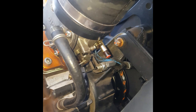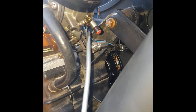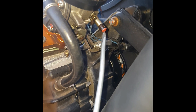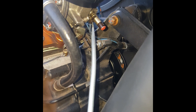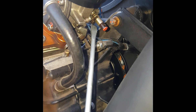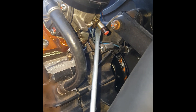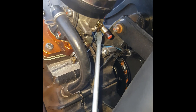But if your motor constantly dies at idle or if it idles very rough, then you need to adjust this screw here. Not the one with the red cap — that's your high needle, sealed from the factory. This lower needle, the low one, is your idle mixture screw or low mixture screw. If your motor is too rich, turn this clockwise; if it's too lean, turn it counterclockwise.